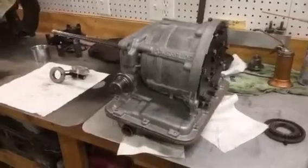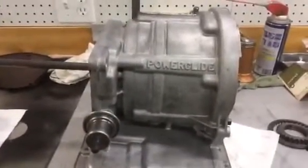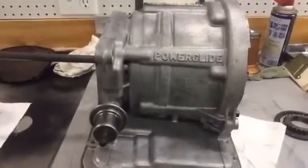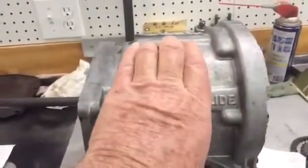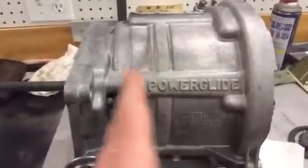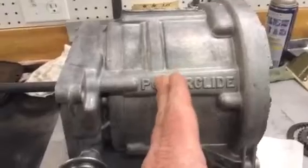Basically what they're talking about here is this is a rebuilt PowerGlide transmission. Everything in here is round and spins — it's got drums in here that are stacked up and the whole unit rotates. Whenever you have a spinning mass of mechanical parts like a PowerGlide, there's going to be thrust forward and backwards. What GM wants you to do is limit that amount of thrust within the tolerances so all these internal parts line up and float basically in the center and nothing wears out.